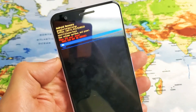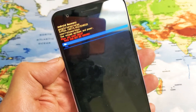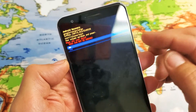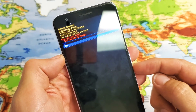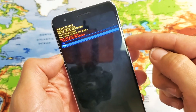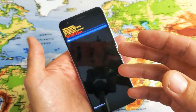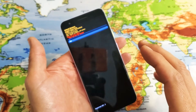And now this message pops up. In red, it says Wipe All User Data — this cannot be undone. Remember, once you go ahead and do this, you're going to lose all data. So if you want to proceed, use the volume rocker down, go down to Yes, and then once you press the power button, it's going to start formatting everything back to the original settings. It's going to reboot the phone and you have no way of going back.